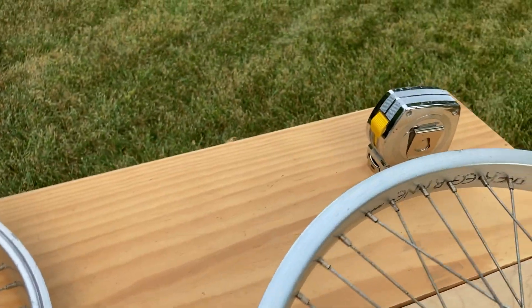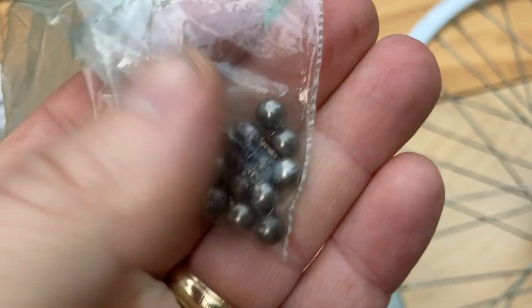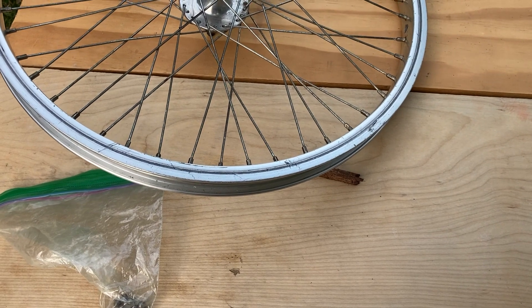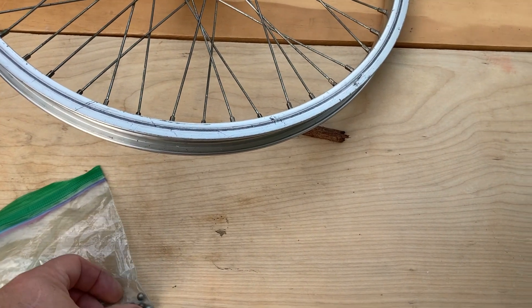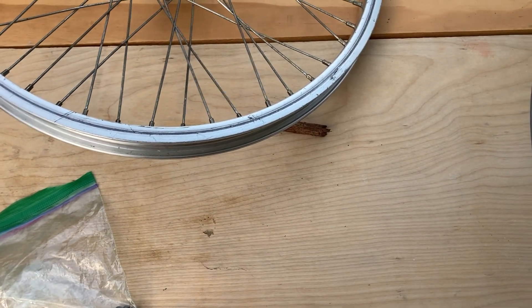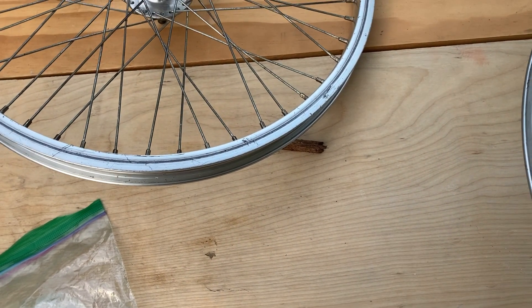One other thing I'll mention is I re-greased both — filled with grease, cleaned it all out really good. The races are all in really good shape, cones and everything. I replaced the rear bearings. You can see that about half of them are nice and shiny and the other half are dark gray. The dark gray is usually a sign that the bearing is beginning the process of breaking down. I didn't find any pitting or damage on the race or anything like that. Peregrine used quarter-inch bearings — quarter-inch and three-sixteenths on the front. Nine on each side in the back, ten on the front.